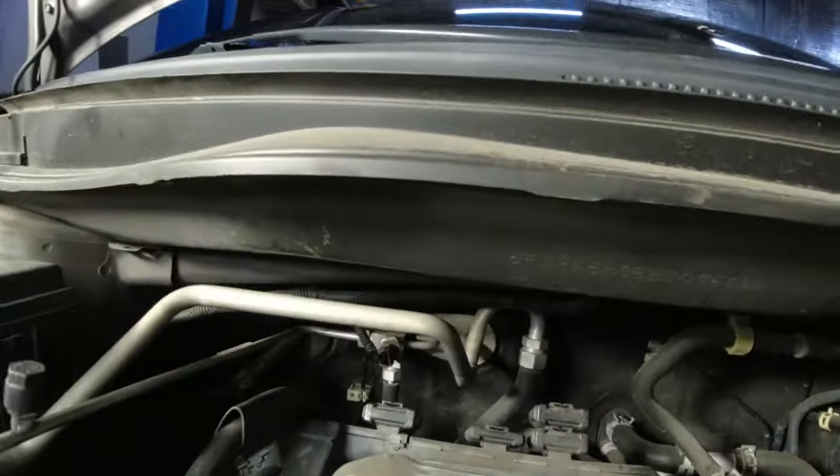I'm going to start taking the AC stuff off. The reason we're doing this is the AC pump is making a whole bunch of noise. The AC doesn't work if you do not have the rear AC on. If you turn the rear AC off, it blows warm air. I think it's the expansion valve that is right back there.